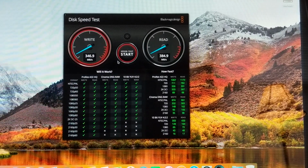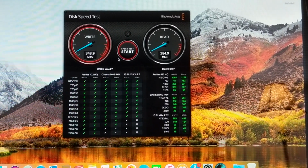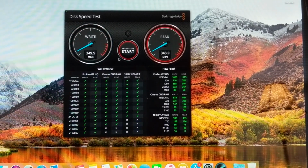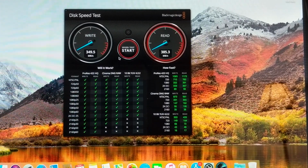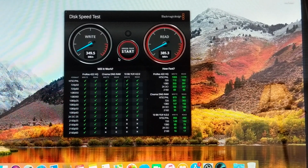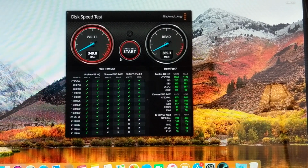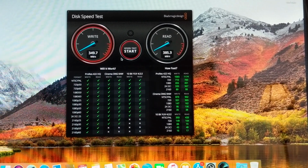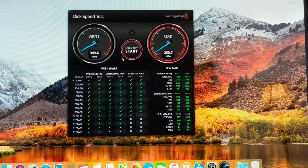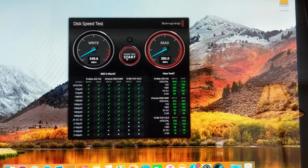And we'll run a few more tests here so you can see it, but basically the reason this is so exciting is because we bought a 2011 iMac for about 280 bucks, and we bought an enclosure with an SSD drive, Thunderbolt 1, and we're able to run the entire OS and the entire system off this SSD drive. And what it does basically is it makes it into a brand new computer. When I put this next to a more recent computer, maybe a 2014, 2015, 16, it's very similar in almost every capability. I put a lot of RAM in this system, and I can edit videos, I can do whatever I want in this system based off the capability of the SSD drive.